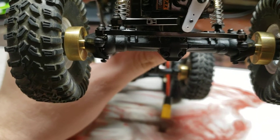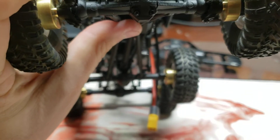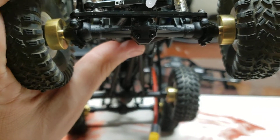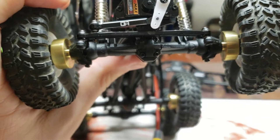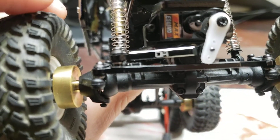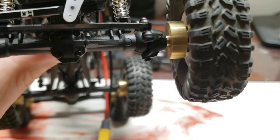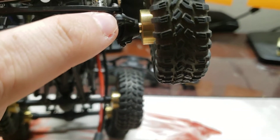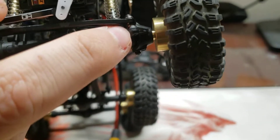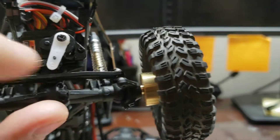All you have to do is take a really fine pick — if you're brave enough, use a knife. Just pull the top O-ring off over the short side, not the long side. Pull it off. Flip out the C-cup inside. Put the O-ring back on so it won't fall off. One side of the C-cup has a longer side — it has a diameter washer built into the cup itself to retain the washers. You want that on the outside where you screw through. You want the shorter side, which can't retain the washer, on the inside, because the inside is going to be pushed up against another piece of plastic or metal.